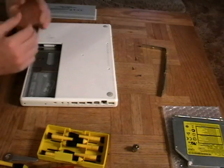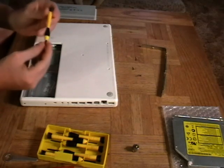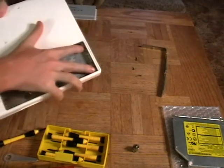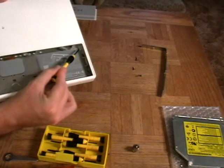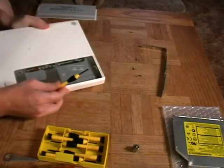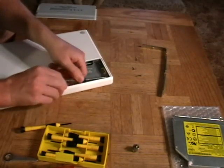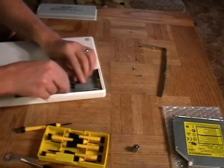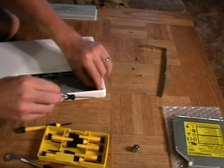I'm back on track here. I had to go get a smaller Phillips head screwdriver — this was a number zero, so if you're at the store, pick this up. The next step is to remove these two screws in there. These are the ones located to the far left and right of this bracket here in the battery area. The organization of these screws is very important, so make sure you have some way to remember which screws go into which location.